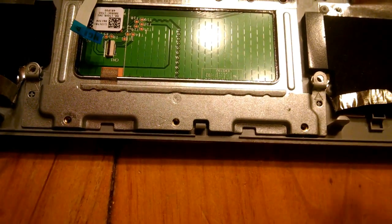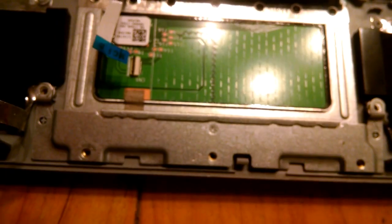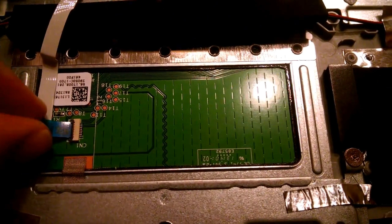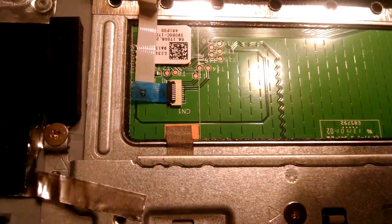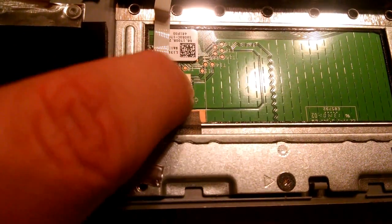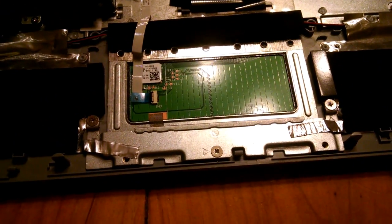So that's the fix - just make sure that little circular bubble is lined up with that pin. Now I'm putting the screws back in and putting the metallic tape back on. Still making the clicking noise. Next I have to put that ribbon cable back in - just keep working at it until you can see a black line next to your finger, then push that black locking clip down and you shouldn't see the black line anymore. That's how you know the cable is seated properly.